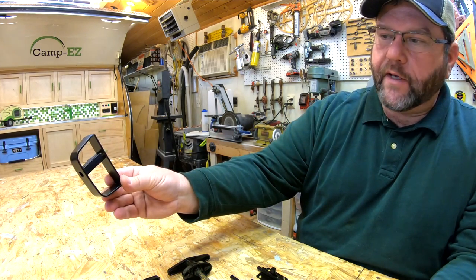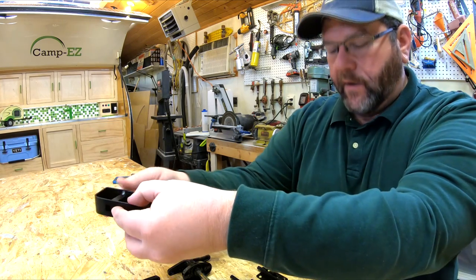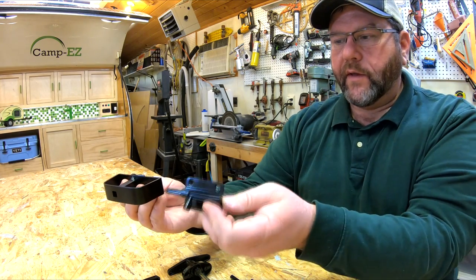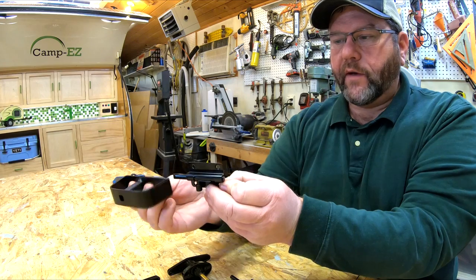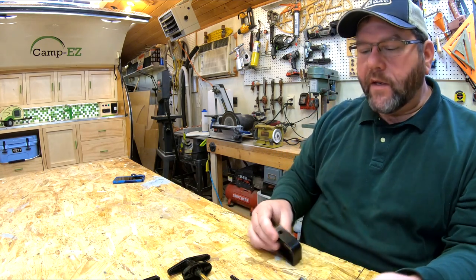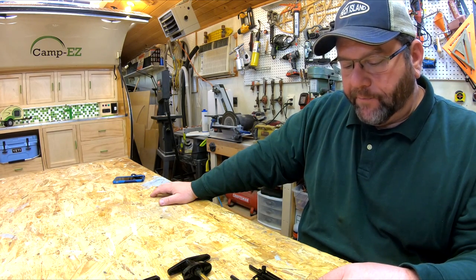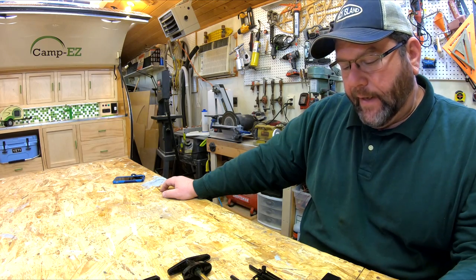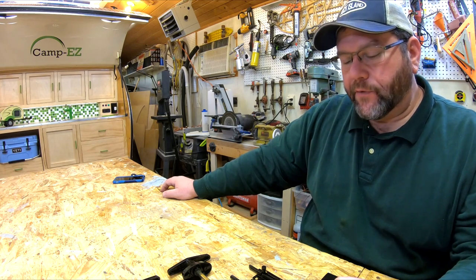The inside of the door has this D-handle that I'll grab to close the door. Then when the door is closed, I'll turn it and latch the door. Then I'm going to use one of these el-cheapo gate locks that I'll basically just plunge into a hole that I'll drill in the end of this D-handle. So when it's plunged in, it'll keep you from being able to rotate the D-handle back and forth, and so you've got a lock on the inside. I couldn't think of anything more inexpensive and easy to install than this. And like I say, if a part does break, I can always just run down the road and buy a replacement part. If I'm out on a trip somewhere and it breaks down, there's always going to be a Lowe's or a hardware store somewhere that'll have a part I can use to get this back going.